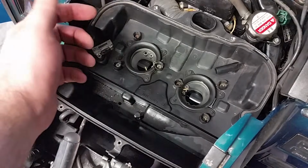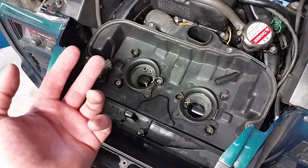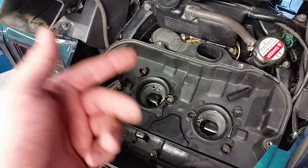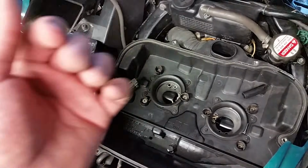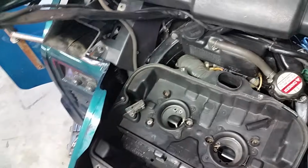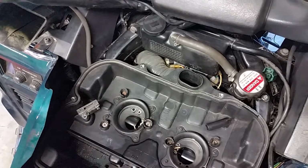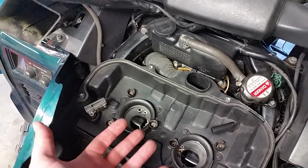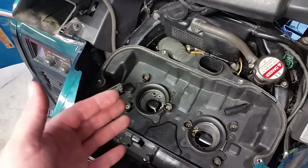And you should take that long screwdriver, which I had mentioned in another video, the oddball tools video. You'll definitely need those to do this carburetor job, because you'll need those long pliers, especially with the curved handles, to get in there and undo all these little spring-loaded clamps and lines and get them off. And then you can use that long screwdriver to come in and get your intake boot. And once you undo the top one, they should pop right off. Trust me, it's easier said than done. It takes a little bit of time.